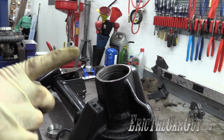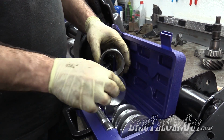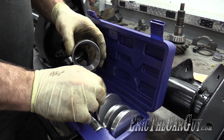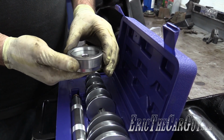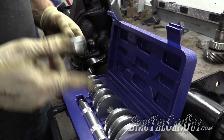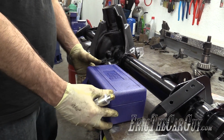I have just the tool for this. This is a bushing seal driver. It's made for doing exactly this. You can borrow these from the auto parts store. I would strongly suggest that you do, because this will help ensure that your bearing races don't get damaged. And yes, this is the first time I'm using this, but I got this tool just for this job because I knew I'd be doing it. Got it at J&B Tools, by the way. Link in the description to this and more.